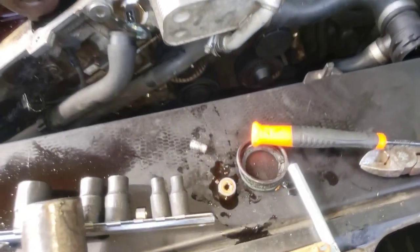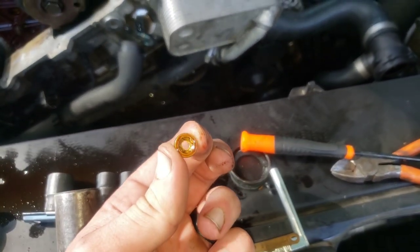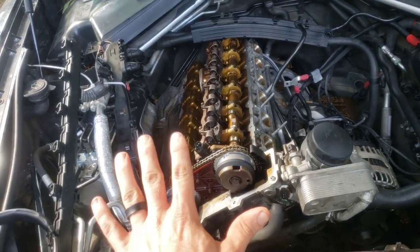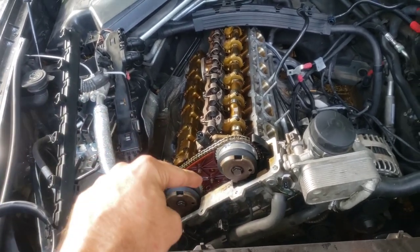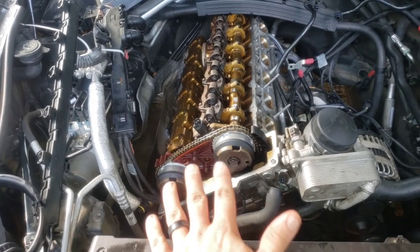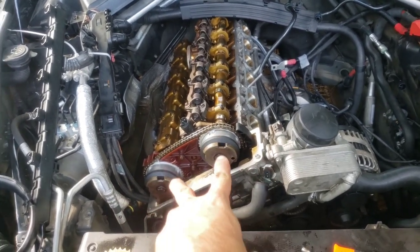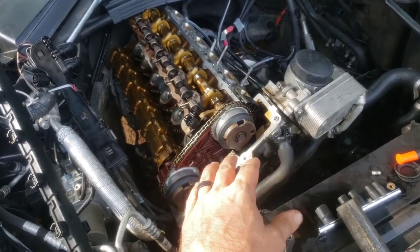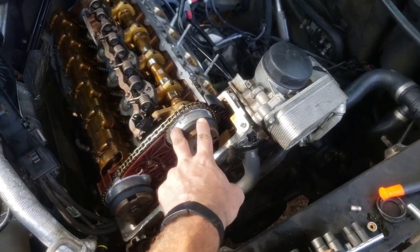And my other one — as you can see, some is broken off in there. Those backed out. This is what they looked like — they're broken. They break off and then sit in the engine and you've got to fish them out. Then you've got to hope that the valves were not bent. In my case, the valves weren't bent. I found one video — I'll try and link that in the description — where the guy was replacing these. He said he got a no-start kind of issue and loss of compression. He changed the thing and it fixed the car.